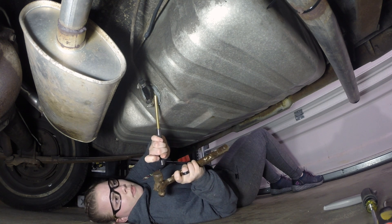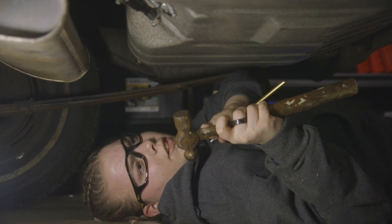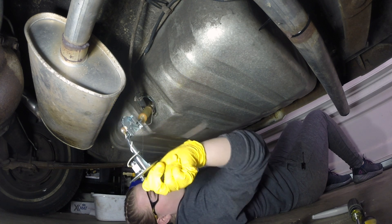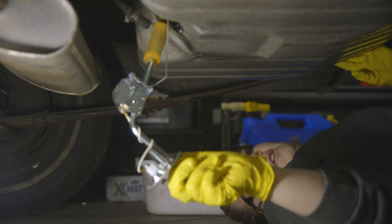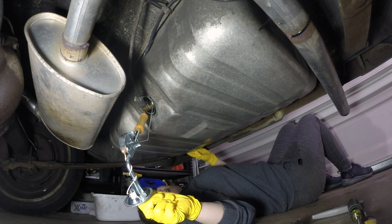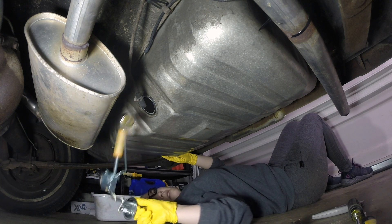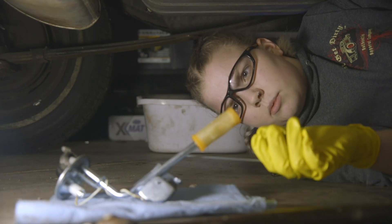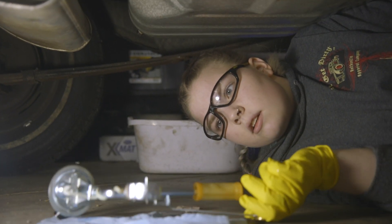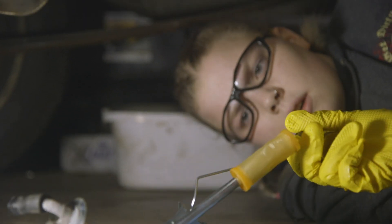It's dislodged — good job. I don't know what this looks like so I don't know how to take it apart. I think that's the float. Wow, this is really different from the other one. That's the pickup right there — the little filter with the yellow thing — that's what picks the gas up. And the sending unit float is that guy right there.